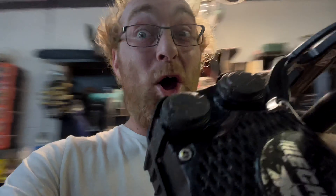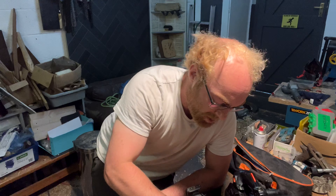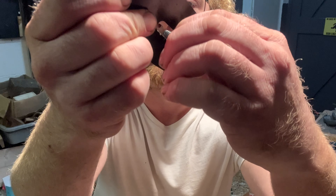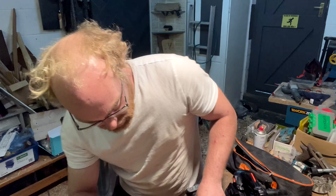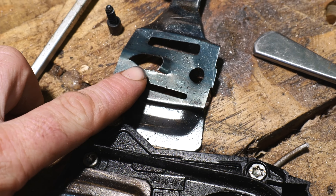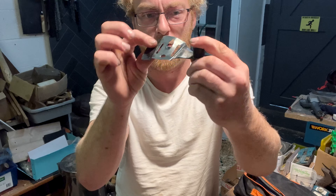I'm not your average tree man, and we're going to try and solve this problem. Let's go! So what we're going to do about it — we need some spare parts. We need any one of these bolts, the pin that holds your bar on. There are two metal plates that sit either side of the bar. This one's alright, but this one we're going to need a new one of — that got torn to pieces.